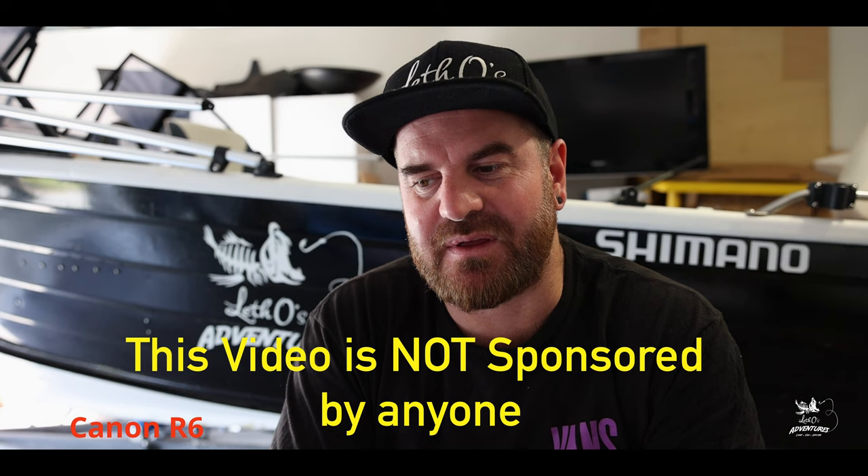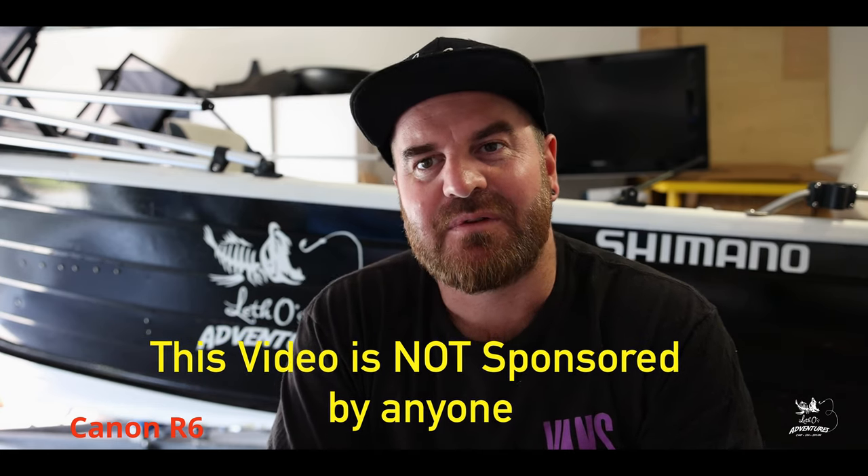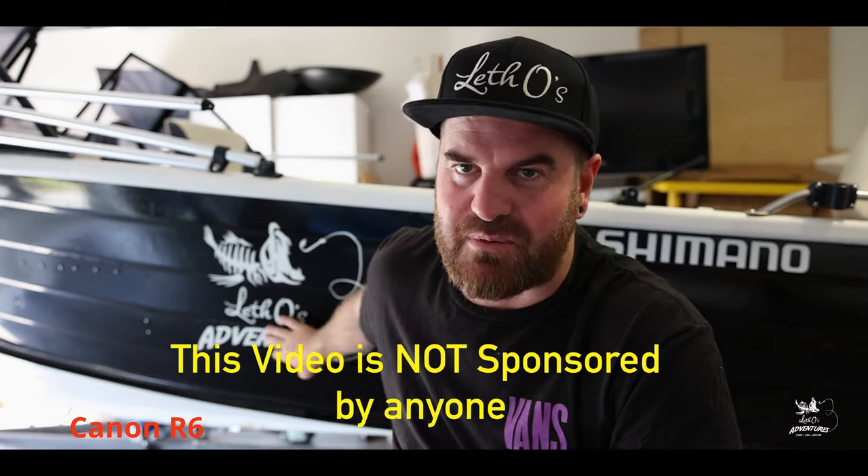I did a video walking around the boat so you can see what it looked like. I then painted the bottom and inside of the boat with a one-pack white paint from Norglass. I really enjoy Norglass paint — it's really strong, that's my personal opinion, and I use it on all my boats. The reason I didn't use two-part paint for the bottom is because of the type of fishing and boating we do — a lot of low tide, shallow water adventures. Sometimes we're actually standing next to the boat pushing it over sandbanks, so the bottom gets scratched quite a bit.